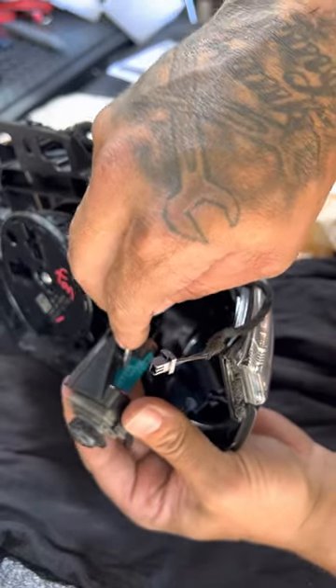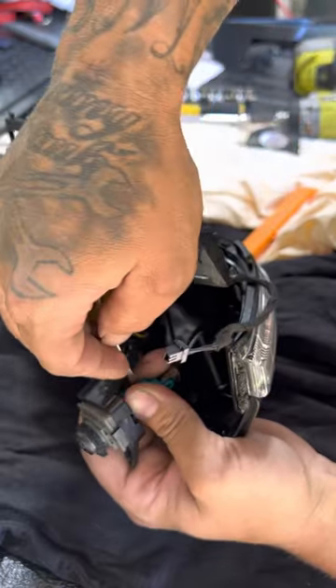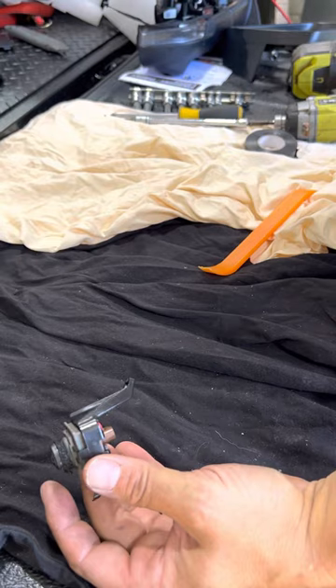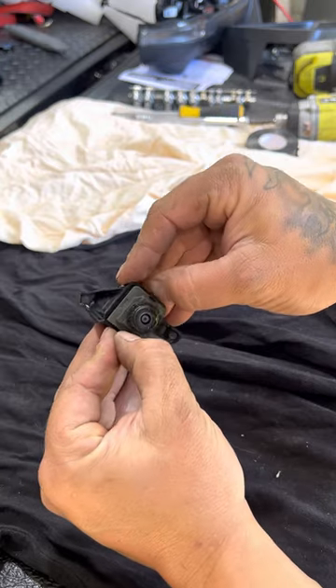On this aqua-colored thing, you'll just see the little electrical clip. If you push down on that, you'll be able to remove the camera. Put that aside. Now these tabs here hold the camera in — you just pull them to the side.